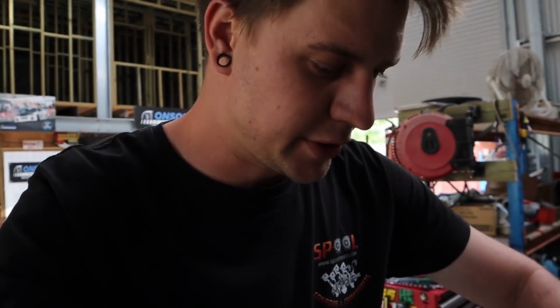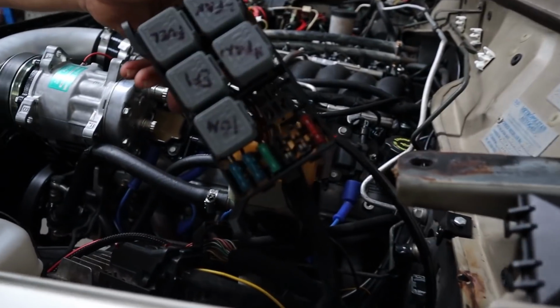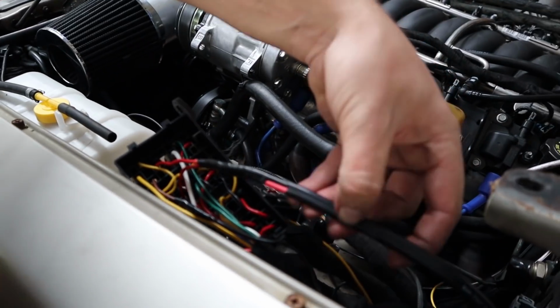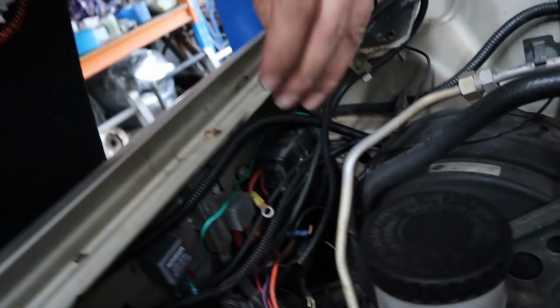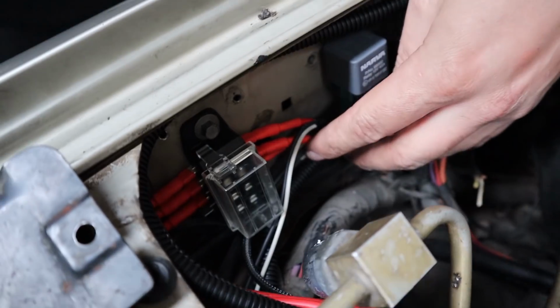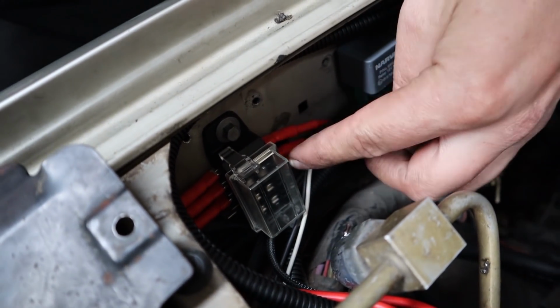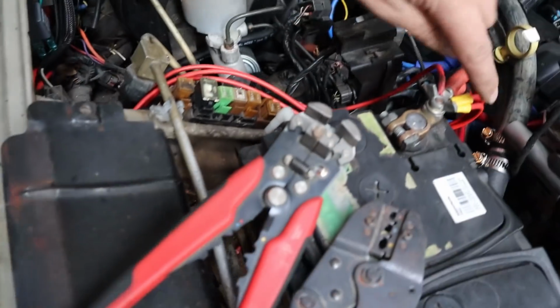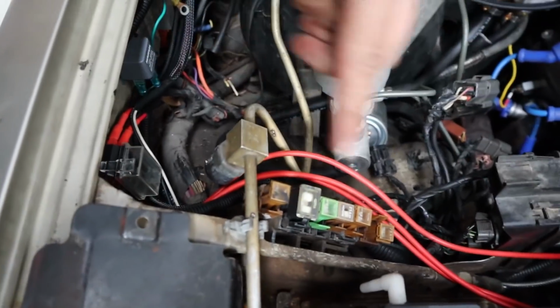All right, so I fixed a few things that I wanted to sort out. As I said, I removed the fan fuses out of the fuse box and hijacked the positives to the relays with this nice big 6mm twin core. That's rated at 50 amps for that big long run all around to here, which I'm a lot more comfortable with, having those fans run off their own power wires like that. They run along here, twin core 6mm, to this new little fuse box that I was talking about last time. The top one is the main power into the fuse box, which is now powering everything else. And they each have their very own power to the battery. It's only a short run anyway, but there's a fuse pretty close to the battery for everything there. I just feel like that's going to be a much more reliable setup than having everything through that one power.